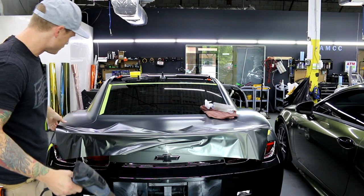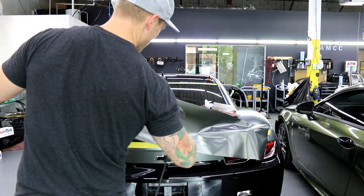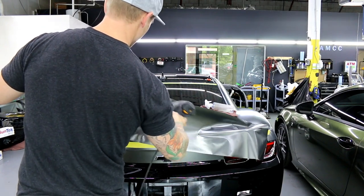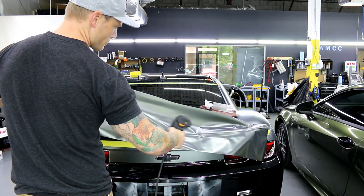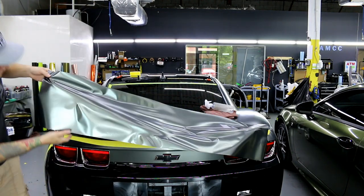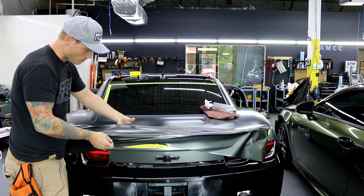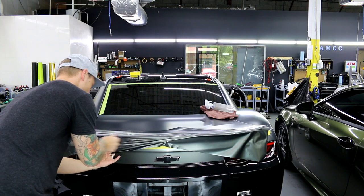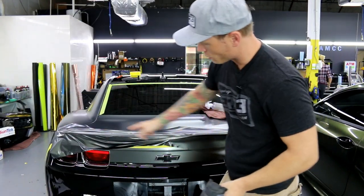We need to exaggerate that. To exaggerate it we can add a bit of heat — my heat gun is on its last leg so I'm heating over a large area. The masking tape is there so we can cut around it safely and the vinyl can slide off comfortably to wrap itself around the edge. Try to get this done in one shot. You can see I'm pulling the vinyl out, spreading it, and pulling it across. I want to make sure we have no wrinkles on this top edge.